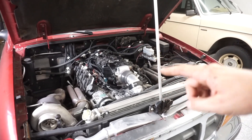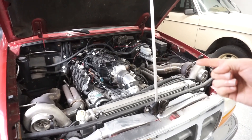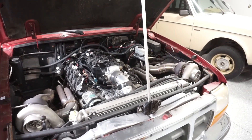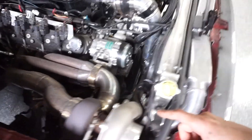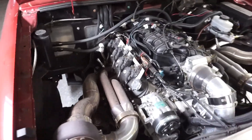I don't have a flex sensor on the car now, so I'm going to have to install the flex sensor in the rear line. Then hook up the coolant combo sensor, figure out where I want to put the back pressure sensor — I might end up pulling the exhaust manifold off and welding it on there. Got to figure all that out yet, so let's get to it.